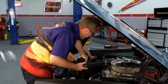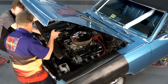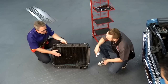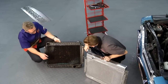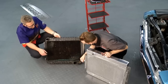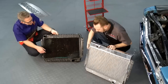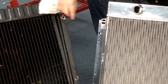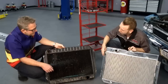We just lift this straight up — a little last-minute fluid there. Matt, these old muscle cars are hard to cool anyway, but look at this radiator. The one we're going to put in — I can see a noticeable difference. With the original copper brass, over time they start leaking at the bottoms where the tubes meet the headers, and some of the fins are getting knocked over which impedes the airflow. The new one has more tubes going all the way across, the tubes going down are closer together, and the fin density is tighter, making it much more efficient than the older copper brass.